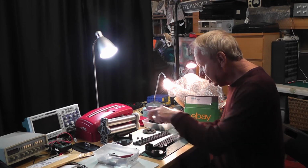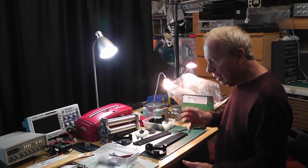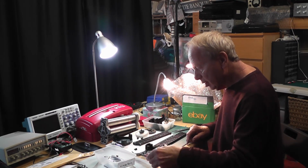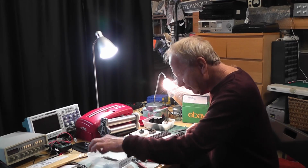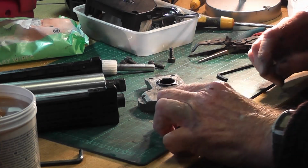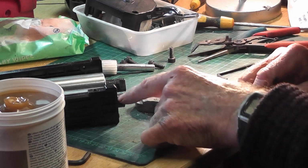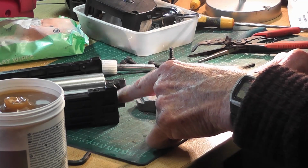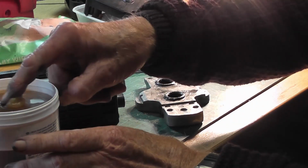There's the spare parts. There's lots of other bits to go together, but hopefully I've got my circlip pliers. Okay, hopefully this will all go well, but one never knows with these things. So let's get started. Reassemble all this. It's very important that it's re-greased, because there's a lot of pressure on these rollers here from the bearing end. So let's do all this.